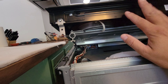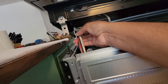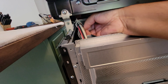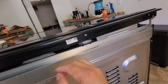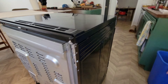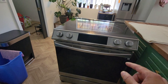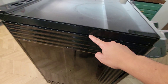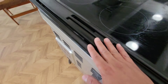Have somebody help you lift it, bring it down a little, and then twist it to lock it in place. Now put the screws in. This is also a good time to clean up the mess behind the range, inside the range, and clean in there because crud goes in there. If anything fell into the fan area, you can vacuum it out.